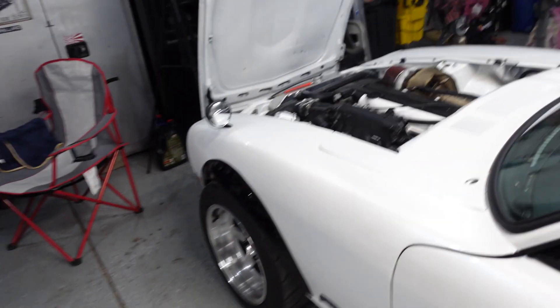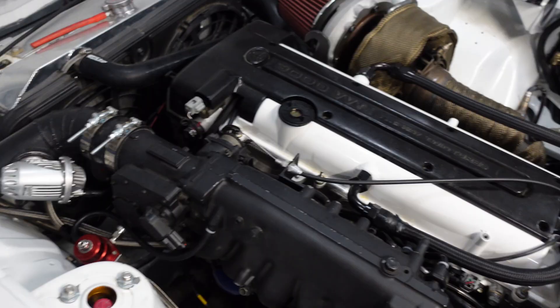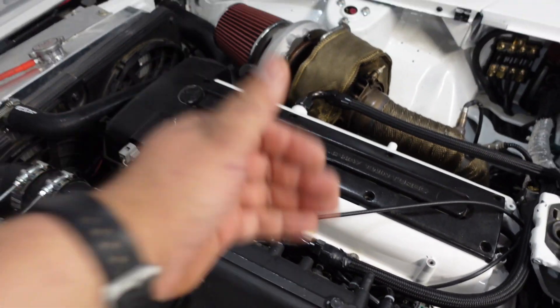Welcome back — it's a fresh day, it's Saturday. We did manage to get the injectors installed and the intake manifold back on. We pressurized the system and we have no leaks, which is perfect. We got some calibrations back from Ian at Ben Calibration and we're at the stage of actually hitting boost.